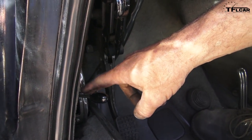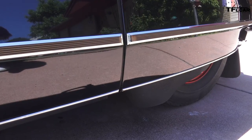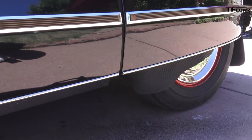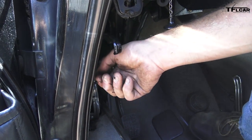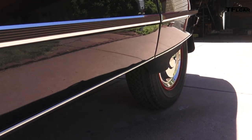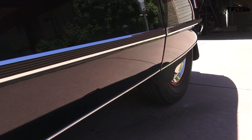The position marked with the large black bar is your ride height — your standard, smoothest ride going down the road, the normal ride height. There are two intermediate positions that raise the car up nominally and still maintain some form of suspension. If you go all the way to the very top, that's for changing a tire. You go all the way down to the very bottom and lock there, and the car will sink all the way down.